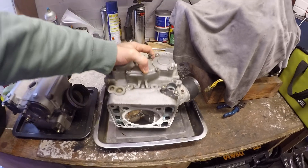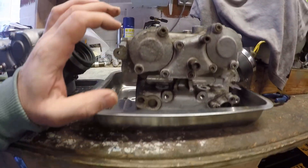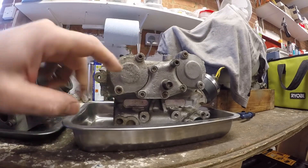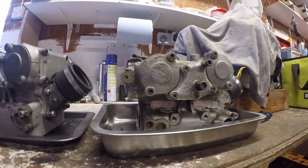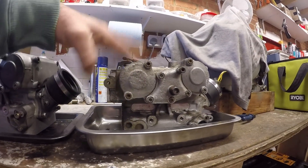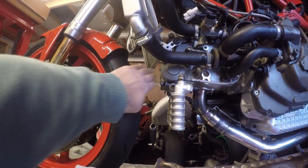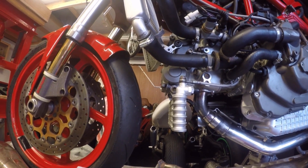This one's all scabby and horrible because the previous owner had left it out in the rain. All that was different is the exhaust side of the head is lower. It has the same cams and cam profiles — it just has a shorter valve train on the exhaust side — and it was to give clearance on the Monster range for the front wheel. So what does that mean for the 748? Well, not a great deal really, as you can see there was never a clearance issue with the standard Desmo head fitted to the 748 anyway.